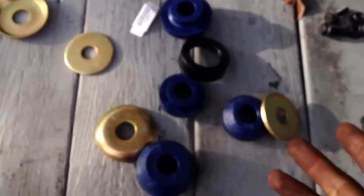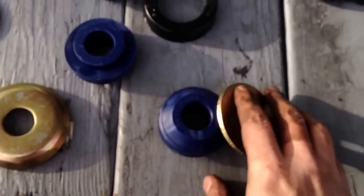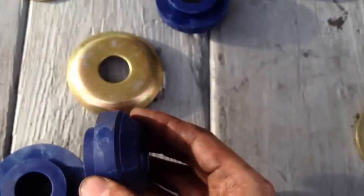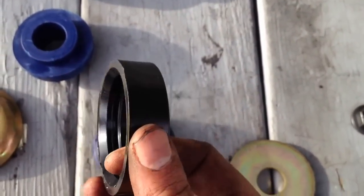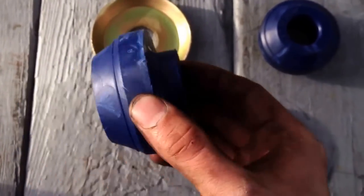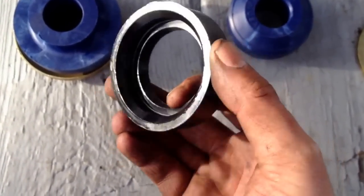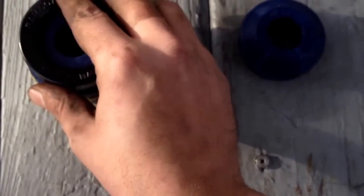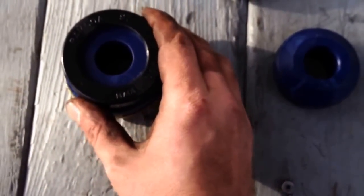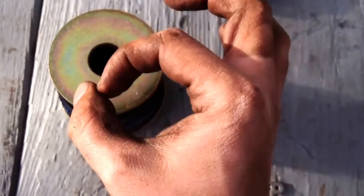In the bushing kit you're going to get a bunch of stuff: a couple of things shaped like a concave-type washer, a flat washer, another piece shaped a little differently than the big one, and finally a plastic-type spacer. The way these go together: the concave washer goes first towards the front of the truck, then the big bushing slides into that. Then the plastic washer — it's got a bigger opening on one side and a smaller on the other, so put the bigger side towards the front. Then the bracket comes next, then the inner bushing piece, then the flat washer, and finally the nut.